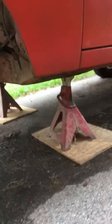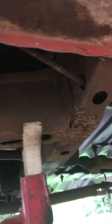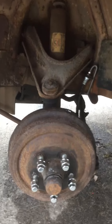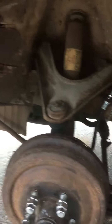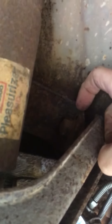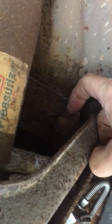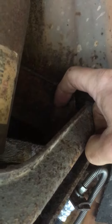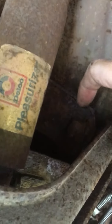So I got up on jack stands. I usually put my stands right in front of the crossmember, just a little bit edged out. And here's one thing I do when you put your car back together so your front-end is not too far out of alignment. On the adjustment bolts, there's actually a little impression, a little dot there. So I take a marker and I black that out, and then I can on the cam on each side reference where it originally was at.